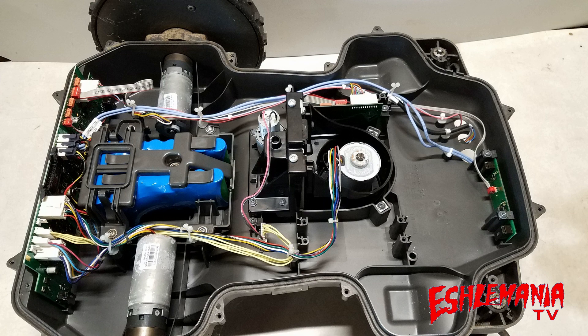Inside that cap is a port to plug a cable into. This is where we plug in the diagnostic cable to connect the mower to the AutoCheck 3 program. That port is on the bottom of the motherboard, so right above that is your main board. The main board receives all the information from all the sensors and decides what the mower should do or shouldn't do, whether it's got a problem or not.